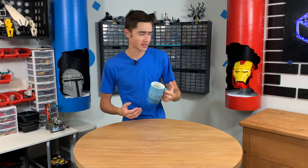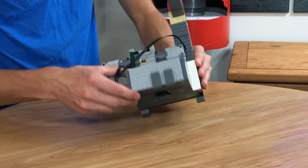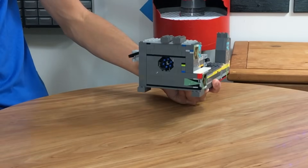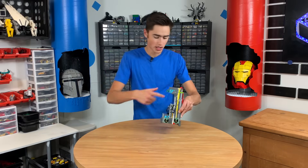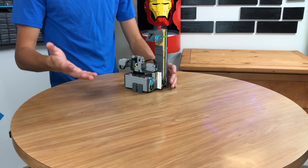It's going to be rapidly chilled like my coffee. Why is it so cold? Here's the pump we have right here, and you can see in the bottom there's a little hole. We got an impeller in there. There's some water coming out still. An impeller, and basically that will spin around, and using centrifugal force, it will suck the water in. The water will spin around, go up this tube, and onto the soda.